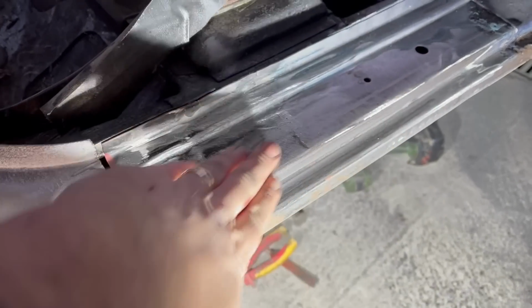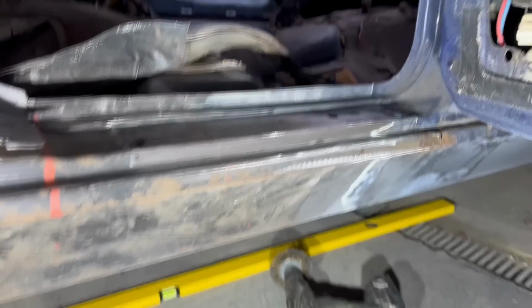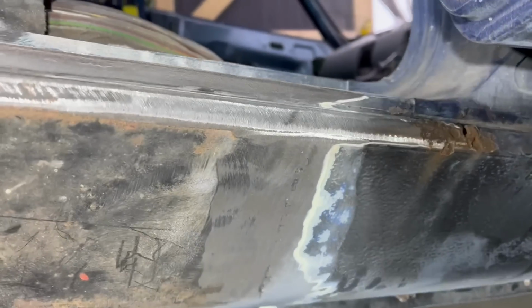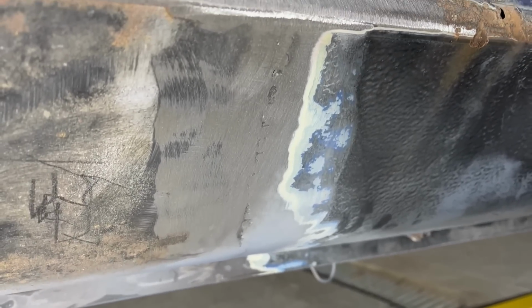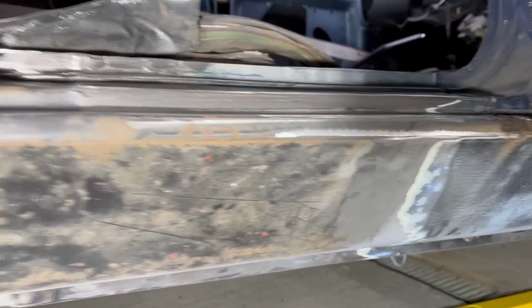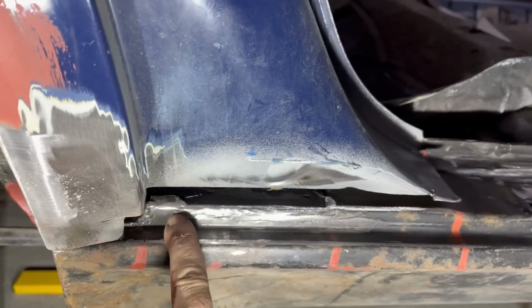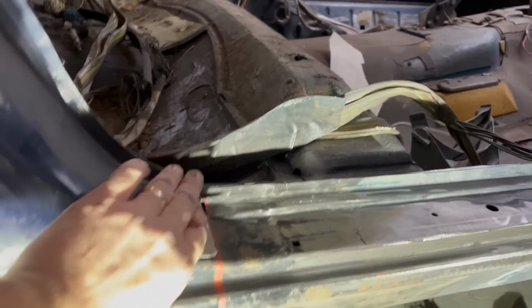That is in. Everything is nice and smooth. I could really go to town, but I can't be bothered. That is, well, very nice shape. It will still need a tiny bit of fill-up. I could go and weld in those things, but there's literally no point. I know there's more than enough strength there, so it's just a waste of time and MIG wire. That's rubbed down. That needs to be flat because this closing panel gets plug welded onto it. That's plug welded and sanded smooth,